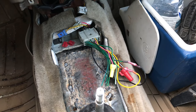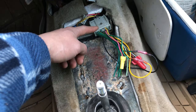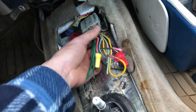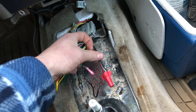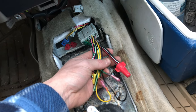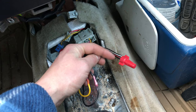You're going to need to remove your center console and all the stuff in there, and you'll be revealed this automatic shifter plug. If you haven't already cut it off the automatic shifter, do so. Make sure to leave these wires and this plug so you can unplug it easily. The two wires we're going to be locating are these two at the bottom — this black and red, and black and white. As you can see, it's much thicker or heavier gauge wire than all the other wires.